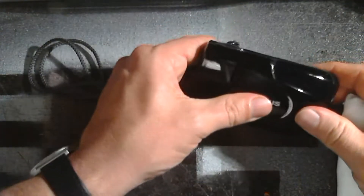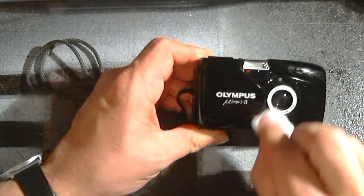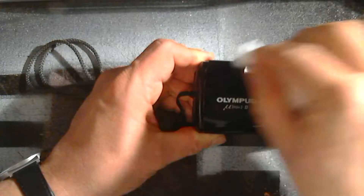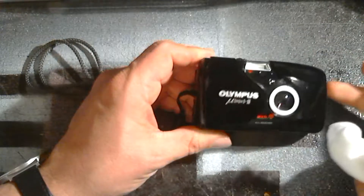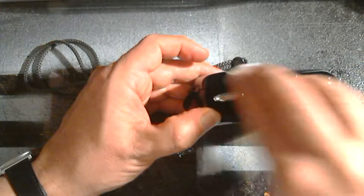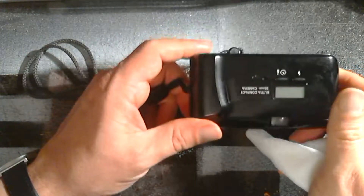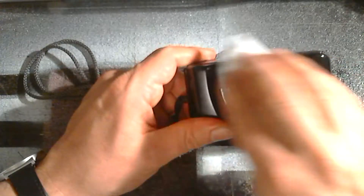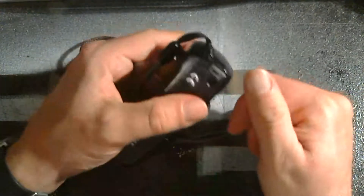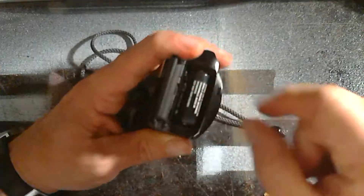I'm not cleaning the lens with this wipe but I will open the lens cover to clean around that part too. Now when you open and close the Mju-2 you should hear a little mechanical noise — this doesn't have that. There is a click when the plastic parts move across each other, but it's not the mechanical noise I'm listening for. That mechanical noise is the lens moving into position, because this lens cover actually turns the camera on and when that happens the lens pops out a tiny bit. But this camera unsurprisingly has a dud battery — market stall sellers rarely have working batteries in their cameras and this one is no exception.